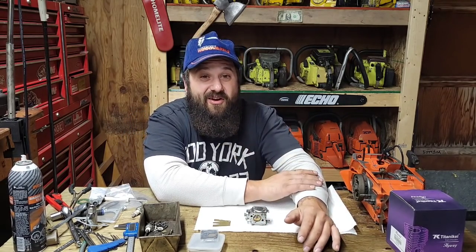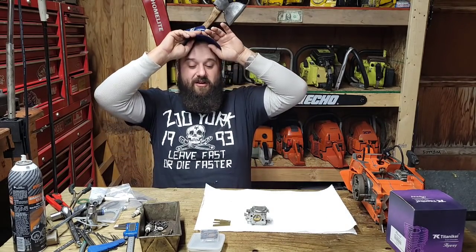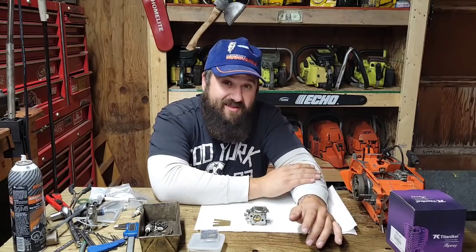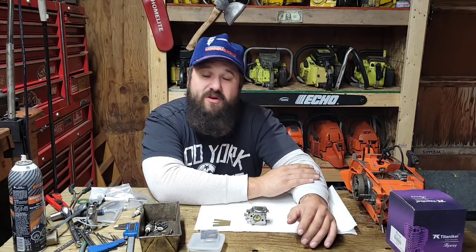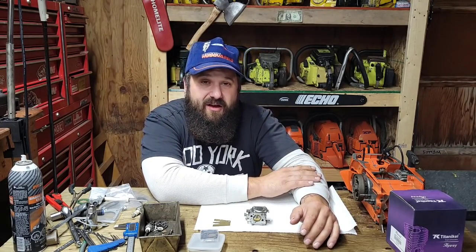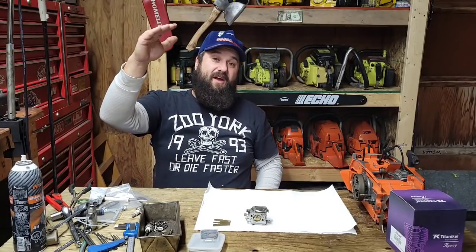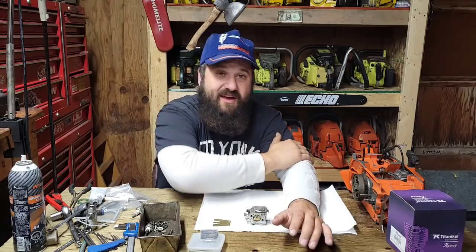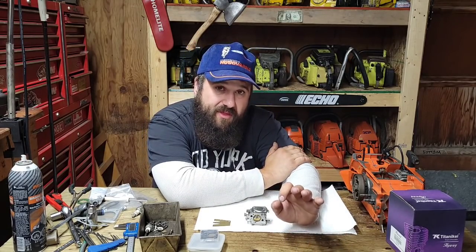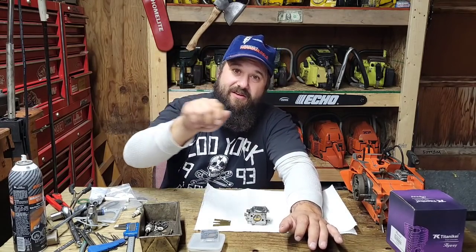That means you guys are learning. You guys picked up on that and that's good. That means a lot of you guys are learning. Even if it was 68, that wouldn't have really affected anything. If I measured when I was grinding, which I did, and I added 5 degrees, say it was 72 and I wanted 77, I would lower the intake on this saw about 50 thousandths. I would measure 50 thousandths and make a line and grind to there.